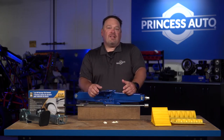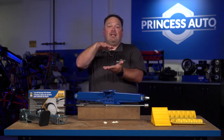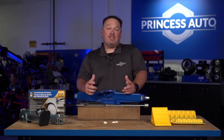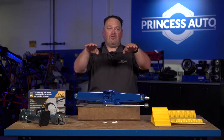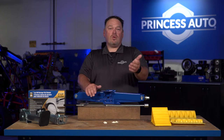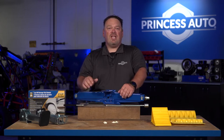There are also stacking blocks — like Lego blocks — that add height so you can level out your trailer. They're typically plastic and yellow; you can add or subtract depending on which way your axle sits. You just back onto them and add more or less as needed. These are especially useful when you're boondocking or at a campground where the ground is muddy, gravelly, or uneven.